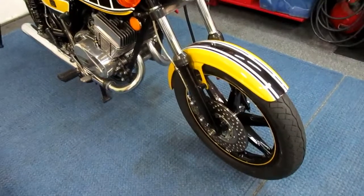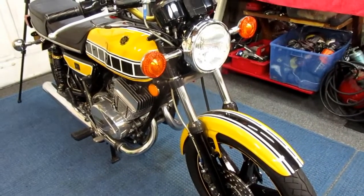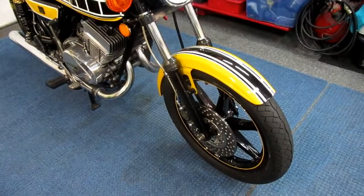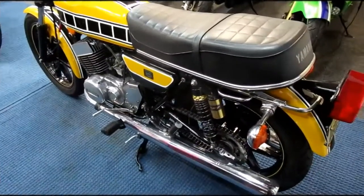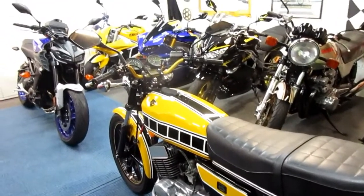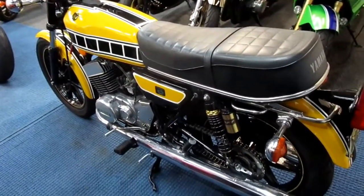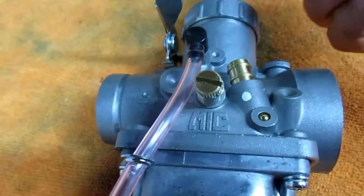And one of the reasons I've always added a little oil is I always wanted to have a little bit of oil in the fuel tank so that when it sat over periods of the winter where I wasn't riding it, I didn't develop any rust inside the tank. And it seems to have worked pretty well over the years. And usually when we go for a ride on the RD, we're with other people with two-strokes, so Luciano, Mark Morgan, for instance, and we ride them pretty hard. So that extra little bit of oil, cheap insurance. So again, an issue that I have to deal with.